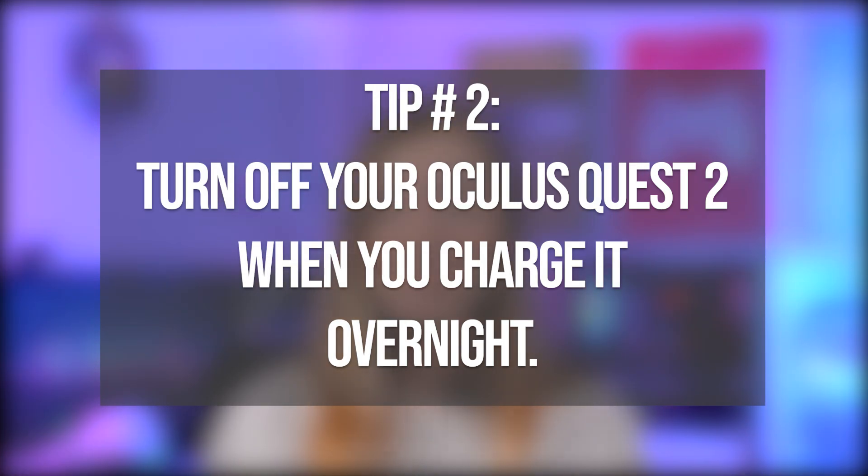What can you do? If you insist on charging your Quest overnight, the safest way is to turn the device off. When the device is off, the charging level drops much slower, delaying the next saturation cycle and resulting in fewer saturation cycles overall during the night. So a good habit is to simply turn off your Oculus Quest when charging it overnight. Keep in mind that keeping it between 20 and 80 percent is not just inconvenient — it also significantly reduces the time you can play, which is already quite short.